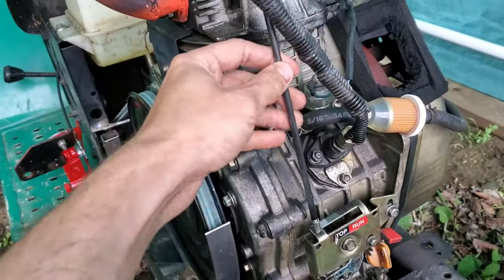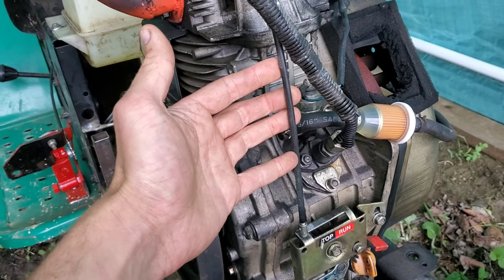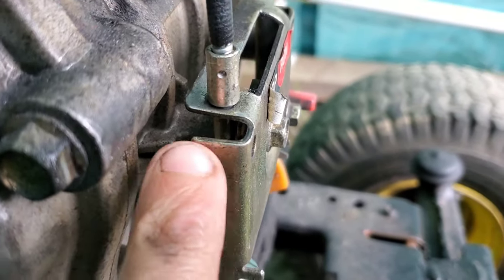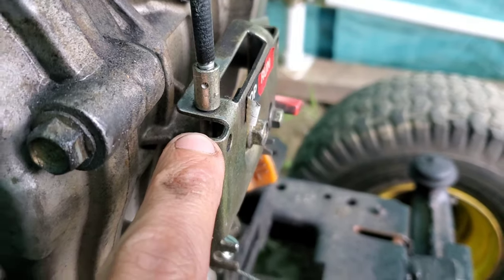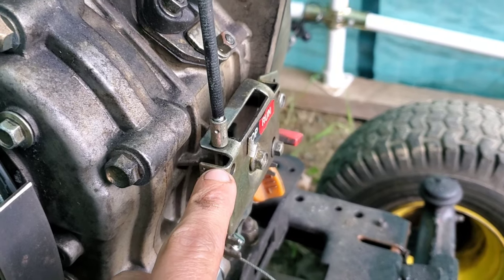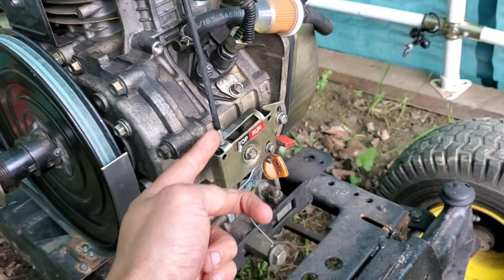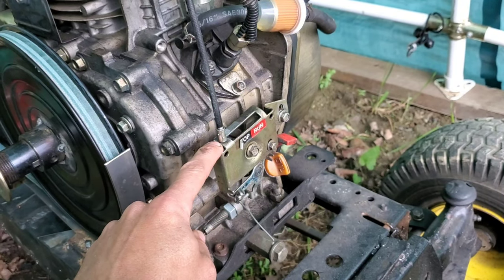This right here is your standard Mako 48-inch throttle cable. I'll include a link in the description. What I like about these is there's a metal tip that goes all the way through. You just drill it big enough that the metal tip goes in, and if you do it correctly there's no reason it should ever come out — you really don't have to do anything but drill a hole for it to port through.